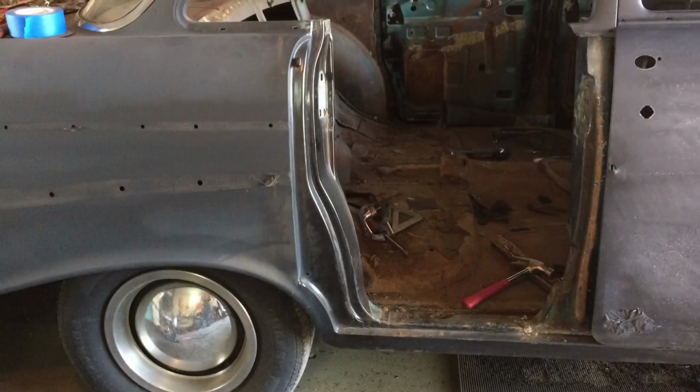I did, though, in fact, remove all of the door hardware, which you can see here. None of the door hardware is in here, and I took all that stuff out and I split the door in half. This was done for a couple different reasons. So I can save material for the inside of the car right here. And not only that, but it made it easier to move this panel around. Which is really nice because then I could access it from the inside as well for beating out dents and things like that, because actually my 4-door doors were not that great. I will insert pictures here as to how I went about doing that.